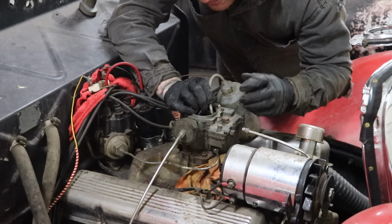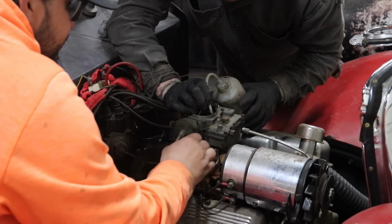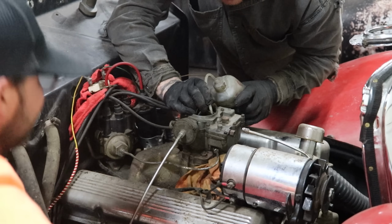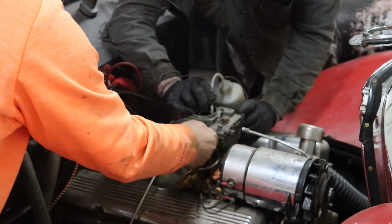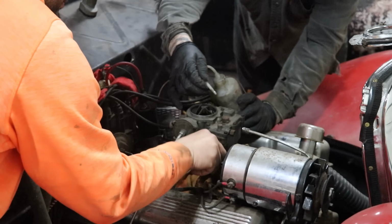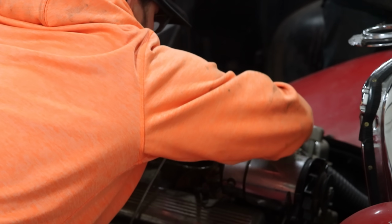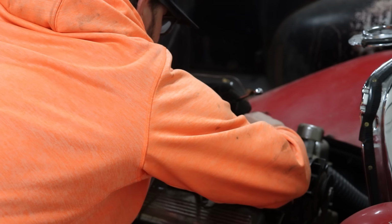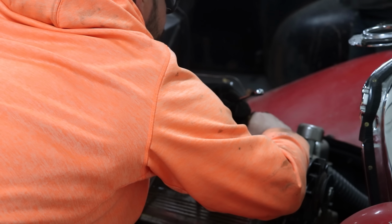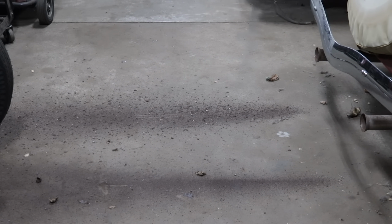Is that getting wet around there? Yeah, around here, but it could be from overspray because it was kind of high. No, it's seeping. All right, so that means we got plenty in there. It's up to the gasket. All right, so we got the bowl full. We can put our feed line back on. Tighten that up, and then I'm gonna put this down. Maybe we'll get lucky and our fuel pump will actually wanna live another day. Put that under here, just in case we'll go.